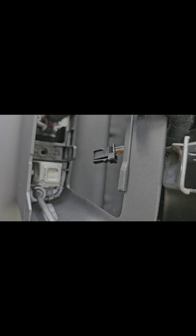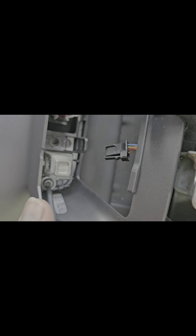Now the fun part. We're going to take this piece that covers the hole and remove it. Use the Torx screwdriver — there's one screw here and one on the other side. This is kind of hard because it keeps spinning. Just make sure when you do that, don't press too hard on the screen to damage it — that's another key point to keep in mind. Okay, the screws are out.